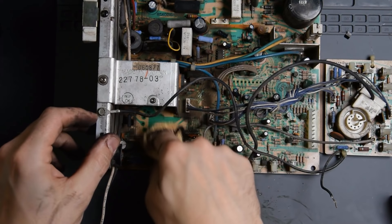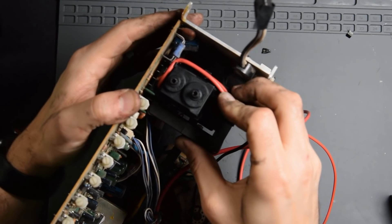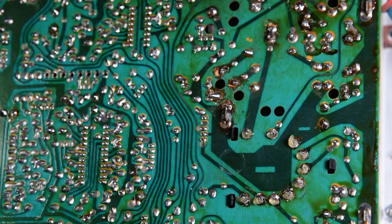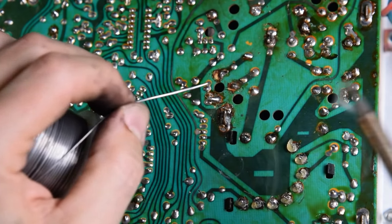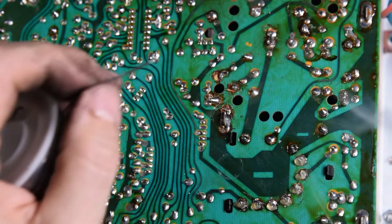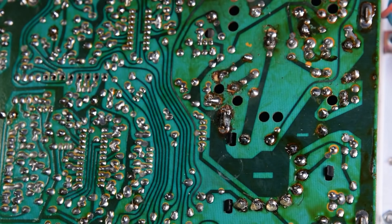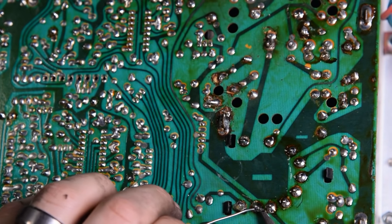Let's get the new one and replace this sucker. But before we do that, I'm just going to clean up the board a little bit. This is probably one of the hardest parts — getting these pins lined up. Once you do, it should pop right through, and on the other end you're going to see your pins. We're going to want to flux them up real nice — be real generous with that flux. Heat that pad up, come in at an angle, and try to get that soldering iron pointed up into the sky after you rip it away. It should give you a nice pointy ball of molten solder. I'm not a soldering expert here — I'm getting better, but it's still pretty rough. If this thing stays on, we should be good.